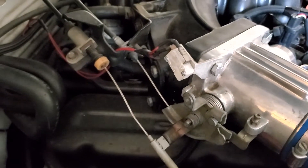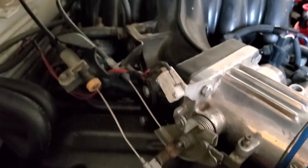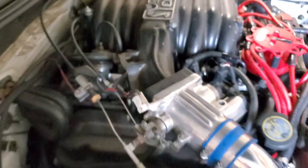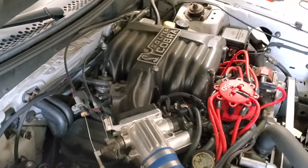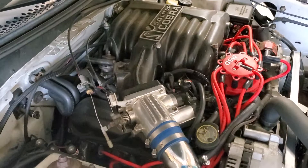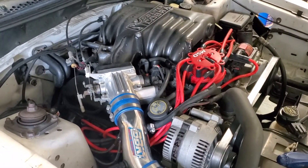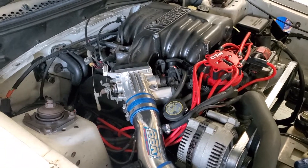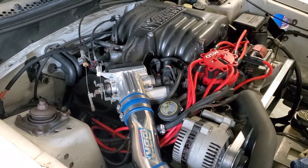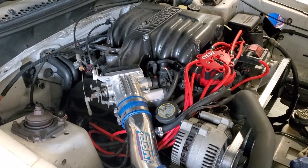Going to kind of get rid of some of the wiring under the hood and clean it up a little bit. I don't want to go too far without the Terminator X kit — it'll be here tomorrow — but I want to get some of the little knickknacks out of the way. As most of you know, SN95s do not like to idle when you put a big cam in it. Somebody had tried to put a chip in this computer at some point; it just wouldn't take, so I'm going to skip all that and go standalone.